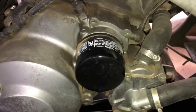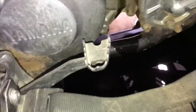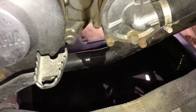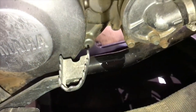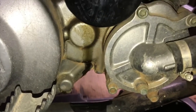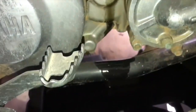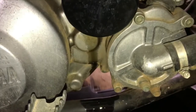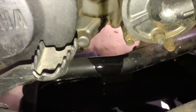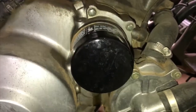On this side you've got to take the oil filter off, and there's absolutely no way to avoid it leaking down onto your shaft or frame and onto the lower part of the engine case. Just let it drip, and once you're done use a little brake cleaner to clean that oil right off, then a rag will straighten it up. I'm letting it leak right now and then I'm going to put the new one on.